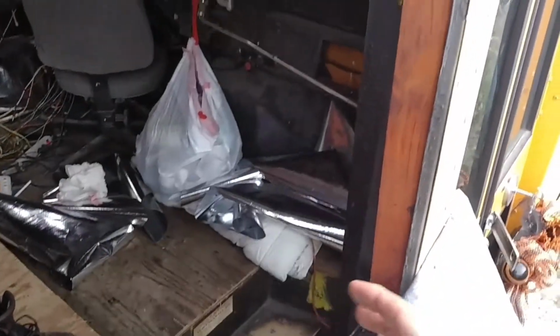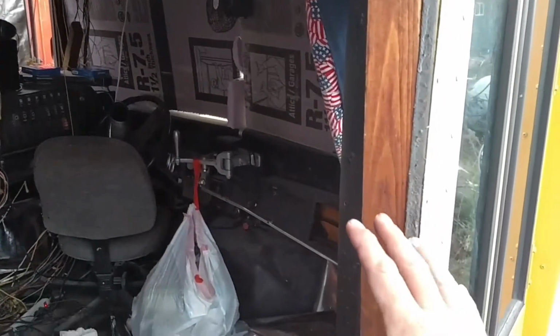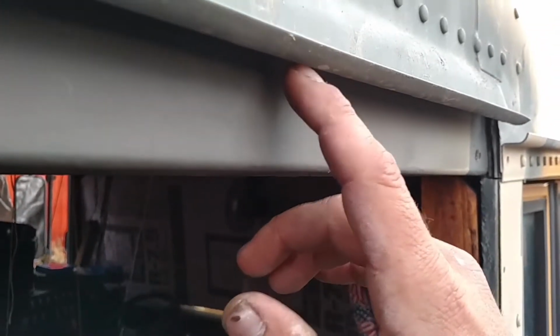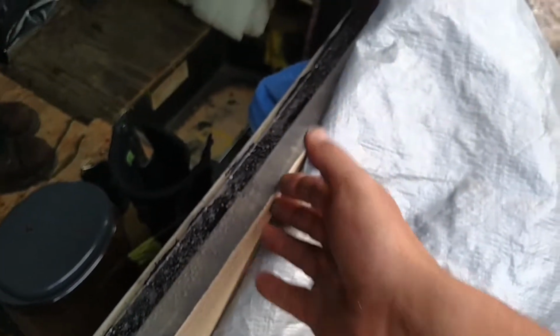That's why if you give yourself some room, you could do some playing with it and get it to work in there. But I measured mine super tight. So what I ended up having to do is I set it up in here, but basically instead of keeping it at an angle right there, I brought it back where it hits this fin, and then lifted up the bottom and kind of worked its way in. Because I also tried setting it from the bottom and then setting it in, and the window fin will actually hit against this fin, and so it doesn't really work like that. But doing it the way I did it, I was able to bring it back, and then while lifting it, it flexed just enough that I could lift this bottom piece up and work it in.